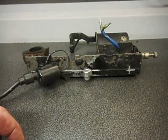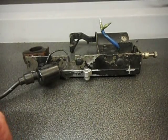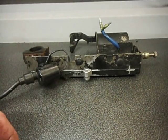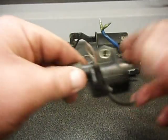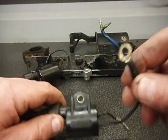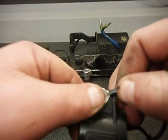What I'm going to do tonight is show you how we waterproof ignition coil terminals. This is for most outboards that use the earth with a little loop with a ring terminal on — so Tohatsu, Yamaha, various ones, Suzuki as well. These have a little ring terminal which goes on through here with a little bolt.